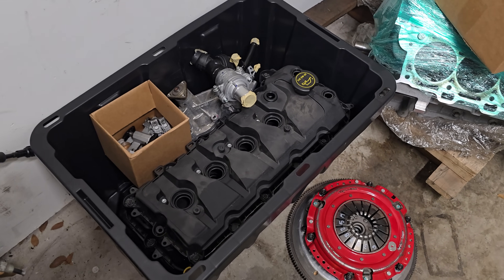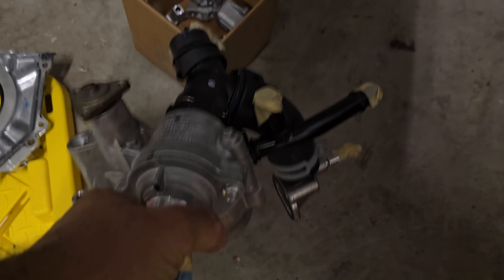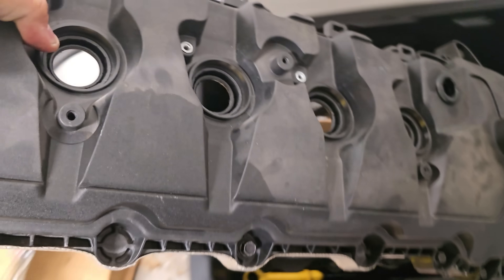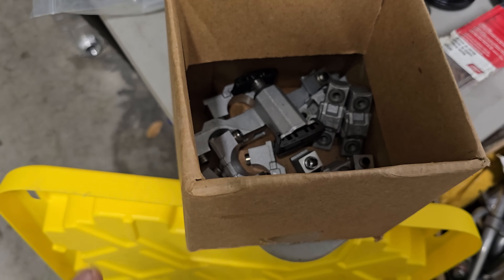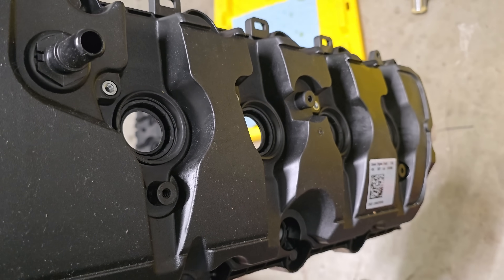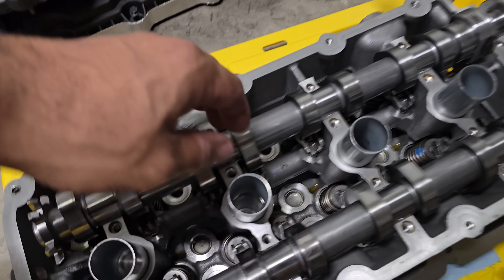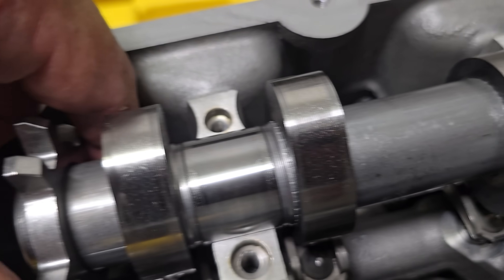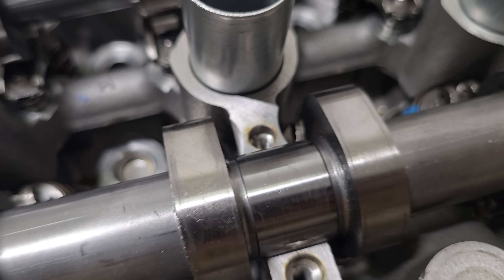I literally got everything. I got water pump, thermostat housing, cam slash coil covers — slash valve cover. These are numbered so don't stress that they're all over the place. The other valve cover slash cam cover. There's a second cylinder head — pull it out. Look at the cams, look at the journals, look for any scoring. No, just dusty. No scoring on the journals anywhere.